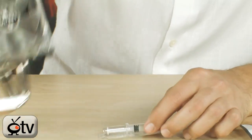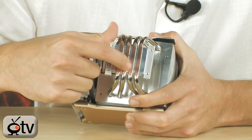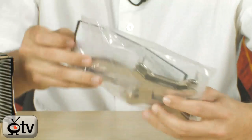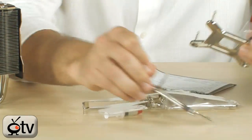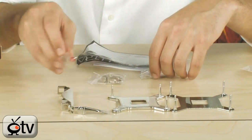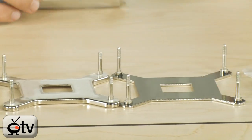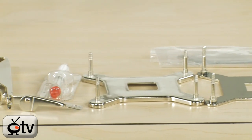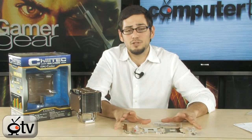You want to cover this area here — it doesn't need to go all the way to each edge or corner, but since the CPU dies are usually right in the middle, you want at least that area completely flat and perfectly covered in thermal grease. Also included in the box is a very nice, high-quality set of brackets and mounting hardware. This works on just about everything — 754 for Opterons and 939s, AM2, AM2 Plus, LGA 775, 1366, and AMD AM3. The only socket it doesn't support is the new Intel LGA 1156.